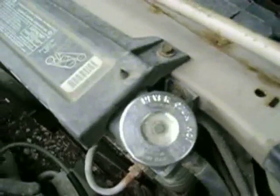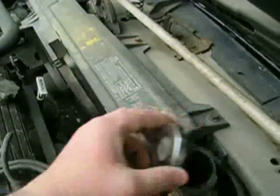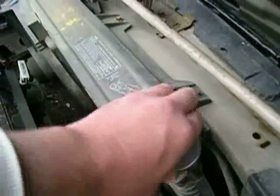This is your radiator cap. You can open this, but don't do so if the engine has been running, because if it's hot in there the system builds up pressure if it's working properly. You can open this by pushing down on it and turning, and then it lifts out. This car could use some coolant — it's not been driven in a while because it's got leaky lines and things like that.